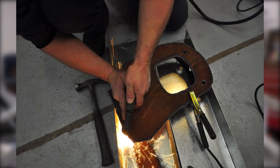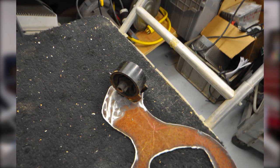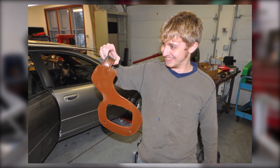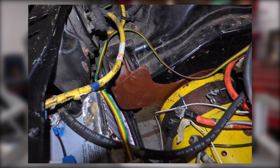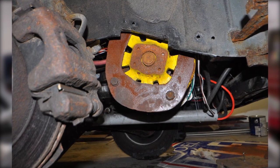I was working with some friends at this point. We had a plasma cutter and arc welder available to us, and that was another big thing with this project — I was really learning a lot by working with other people. I had a friend who knew how to weld: 'Hey Rich, show me how to weld, teach me some of the tips and tricks.' Basically we cut out this shape from a piece of steel about an eighth inch thick, then essentially just welded that rubber mount onto it, slid the whole thing down between the electric motor and where the mount went in the car, put in the bolt that held the mount in, ran the two bolts in there, and that way the back end of the electric motor was held up. The transmission and the electric motor, just like the engine was, was all held in place with three points of contact.